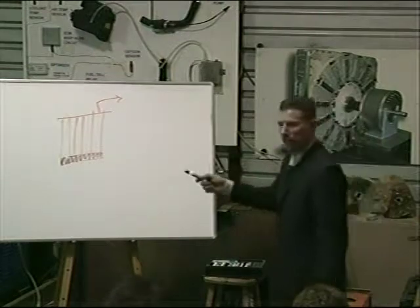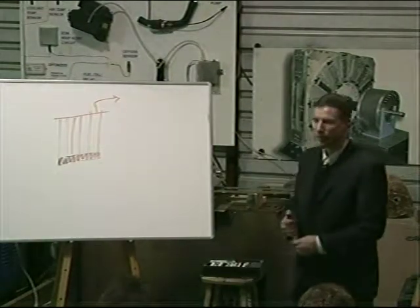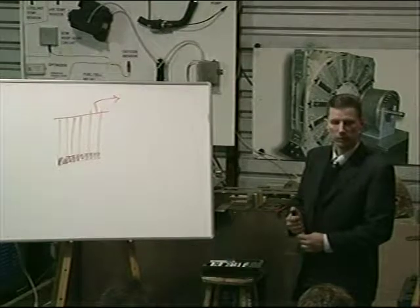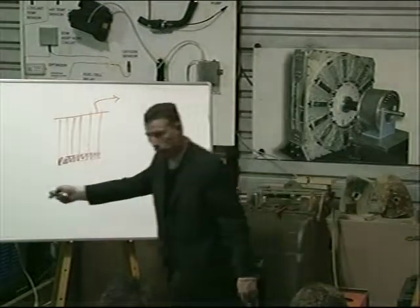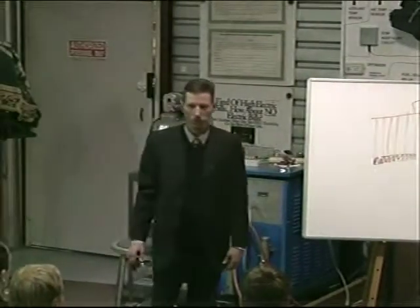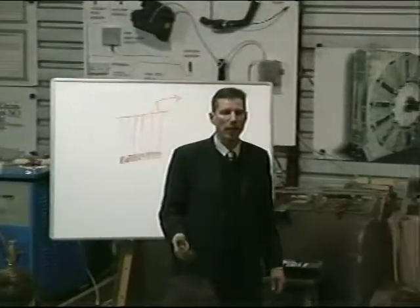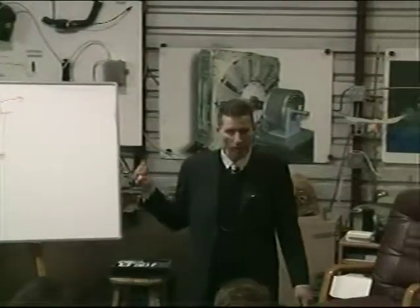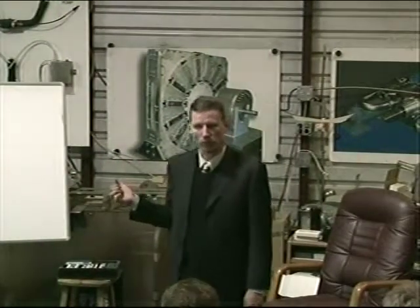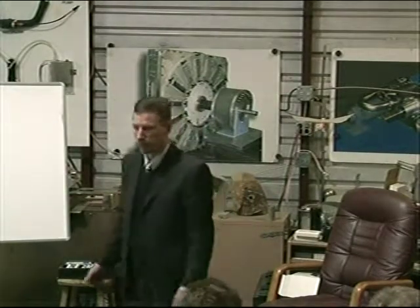Now, if you short out the plates, you can draw 50 amps and not put a half a liter out an hour, huh? So this little test becomes a diagnostic tool down the road. I assure you, if you've got a clean fuel cell, you're using distilled water, and you get the 15 amps, you don't have to do that test on every install. You want to do it once or twice while you're getting your feet wet with it, great.